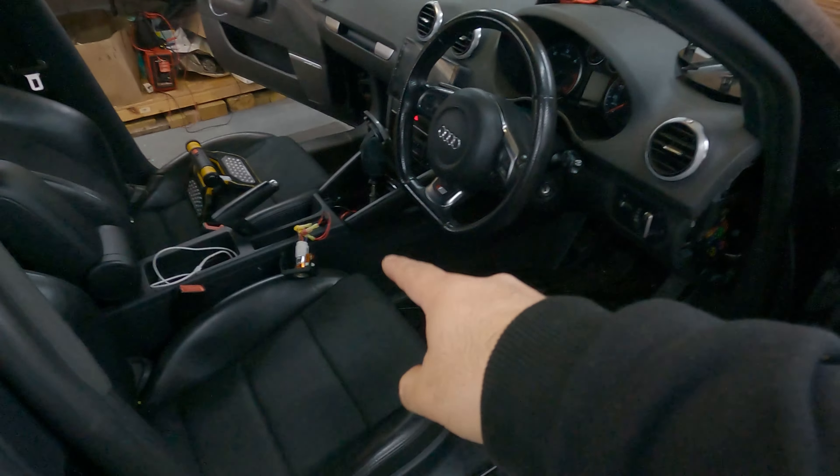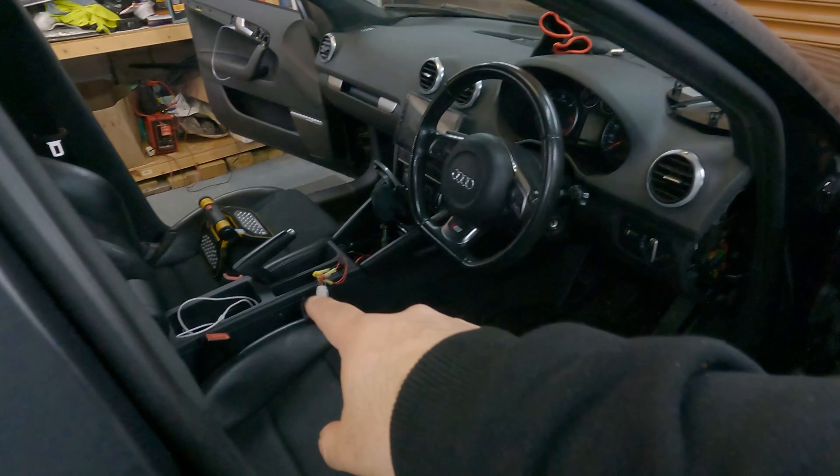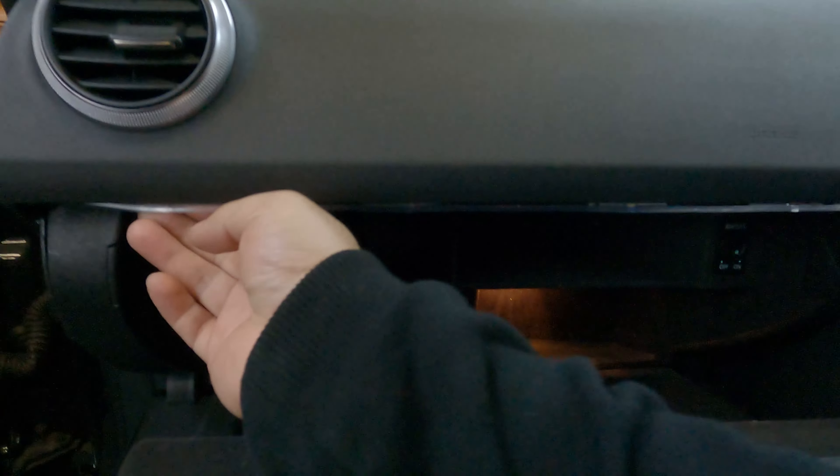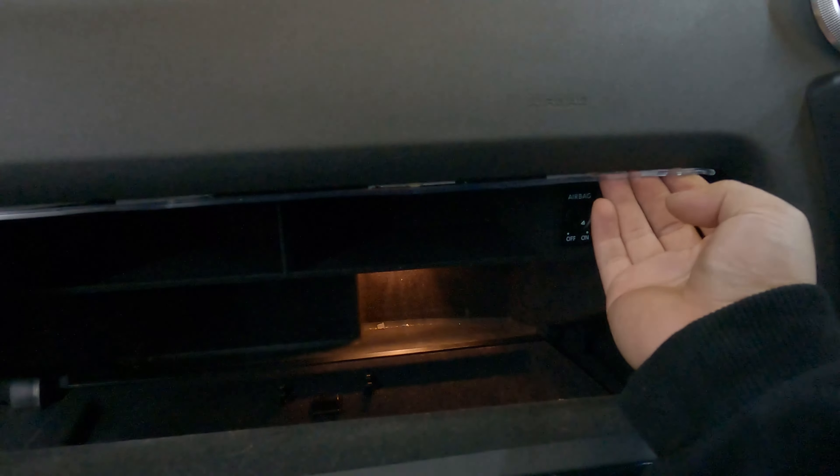The gap in this section was actually quite large so I've had to use some tape to get it to stay in there. Now I'm doing the same on the other side, and bit by bit I can start buttoning everything up and making sure all the wiring is connected. The live here is for the headlights, which the command light is connected to. The red and black is the main live and the brown is the earth for the rest of the lights — footwell and the other light are powered from the main live, and the command light is powered by the ignition live.